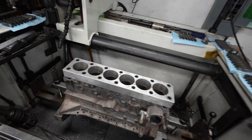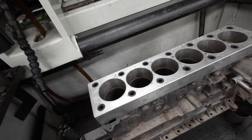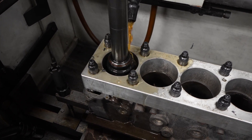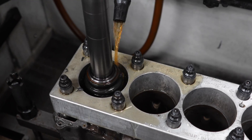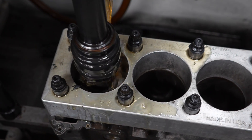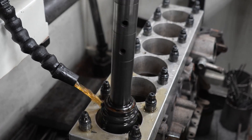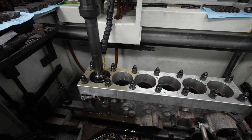This is the torque plating and honing process. It's very important that you use the torque plate because it simulates torquing down the head — when you tighten the head down, it slightly warps in towards the block, and this ensures that your cylinder bores are perfectly straight all the way through. That's important so your ring clearances are actually contacting the cylinder walls, reducing blow-by — your engine is going to last longer and perform better. This is a newer CNC-style honing machine and it can get these cylinder bores perfectly round from top to bottom.